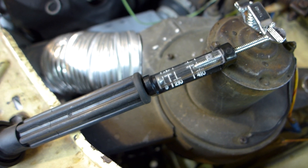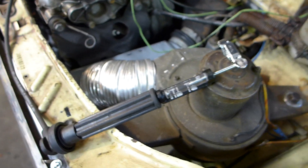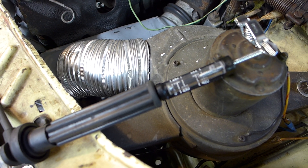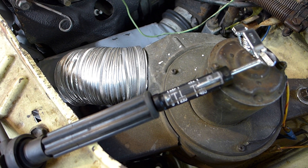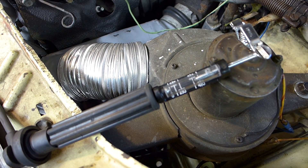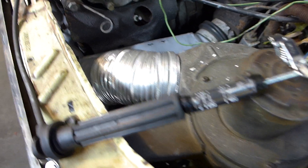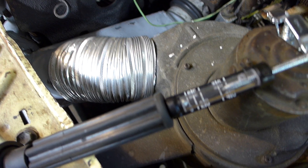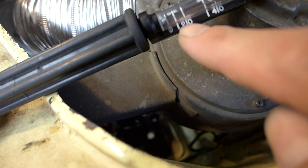In today's world that's not a lot — most electronic ignition systems in today's cars, 80,000 volts are not unheard of. So I wanted to increase my voltage; I think it might help at rev, also be more efficient, get better mileage, the whole bit. I tried some new points, tried some new spark plugs, and got it up to about 20,000 volts, which is pretty good — that's the second mark right there.